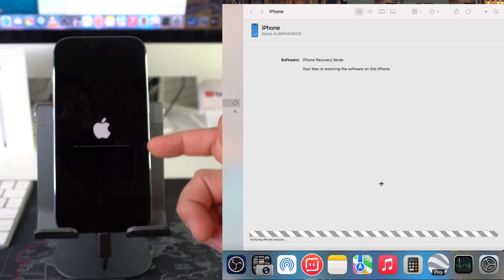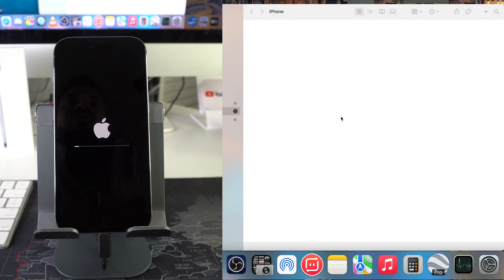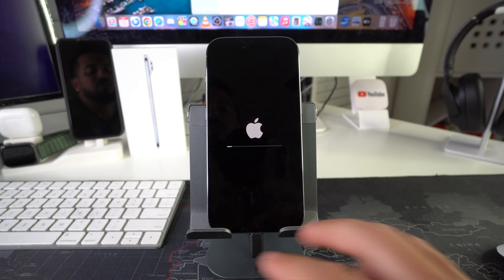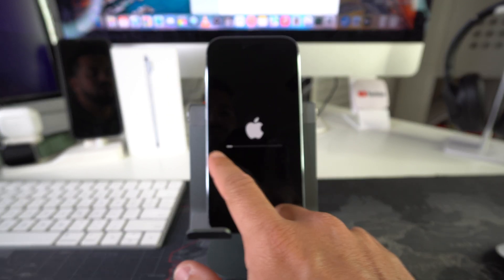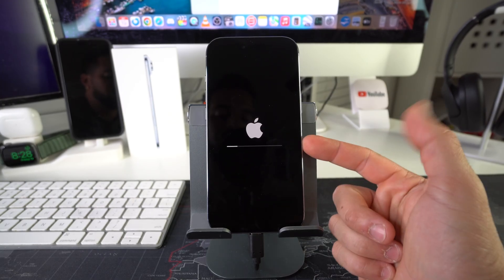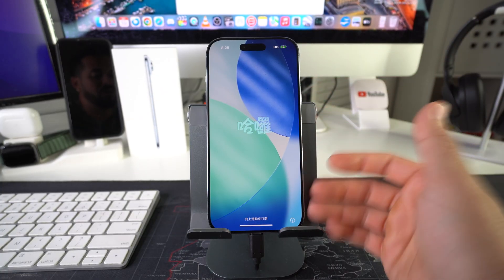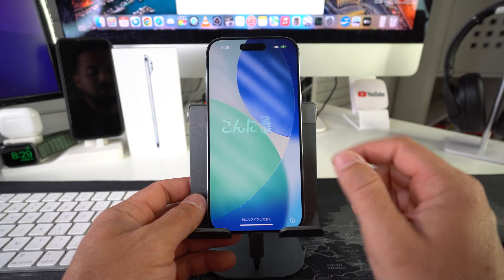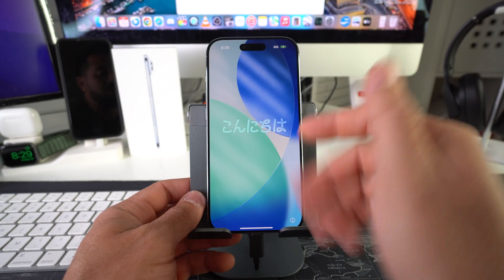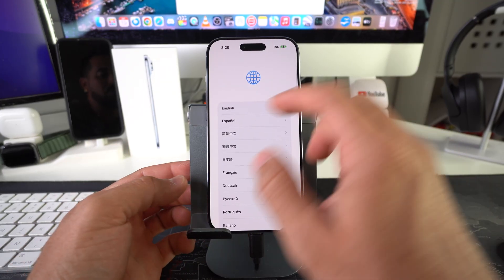This is the final loading bar — and there we go. Now we get the message on the computer which says: your iPhone has been restored to factory settings and is restarting. Please leave your iPhone connected. That means the process is complete. Let's leave it connected with the cable until this process completes on the iPhone itself. After a couple of seconds or a minute or two, the iPhone will complete the process on the loading bar and will boot on automatically. And now you're at the initial setup of your Apple iPhone.